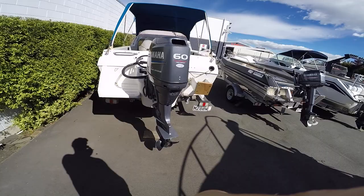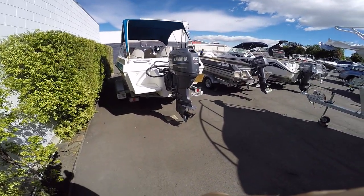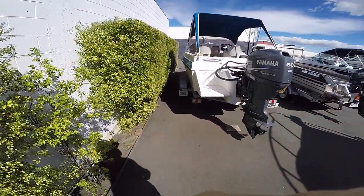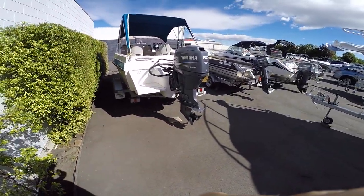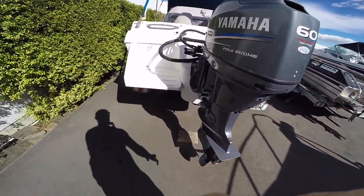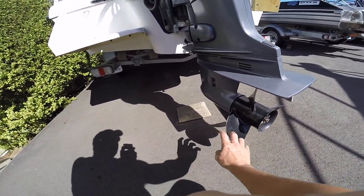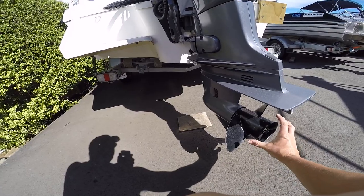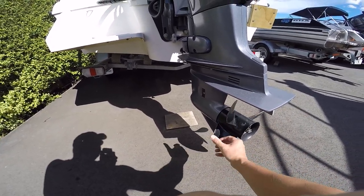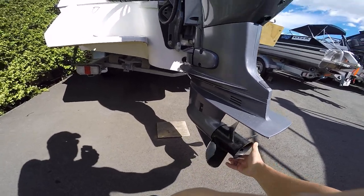When you're buying a boat, you want to definitely go out for a spin in it if you can, or you want to see it tank tested or run with a hose. Make sure the prop spins round. There's a shaft in here, pins here and there. If this has had a clout of some description, you don't want this to be bent. Make sure the prop's got no chips in it or anything like that — make sure it's spinning around, okay?